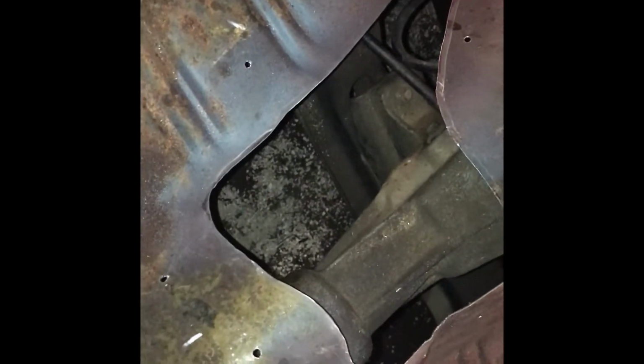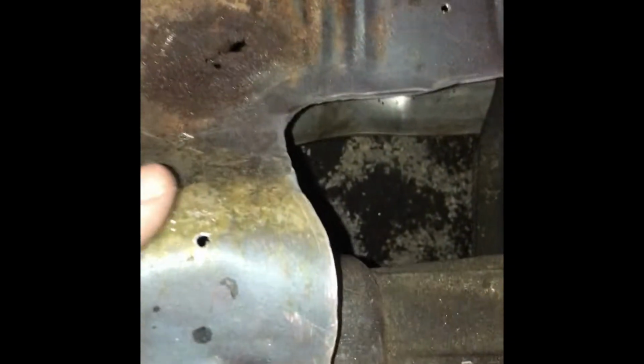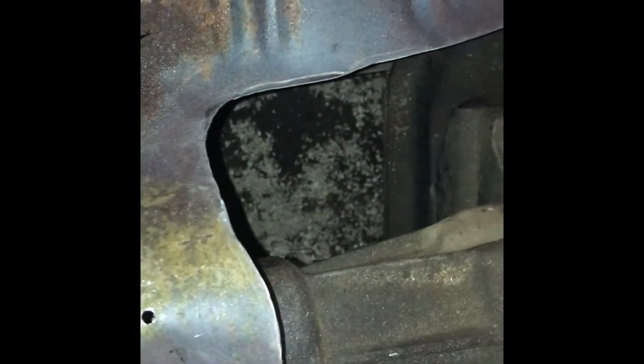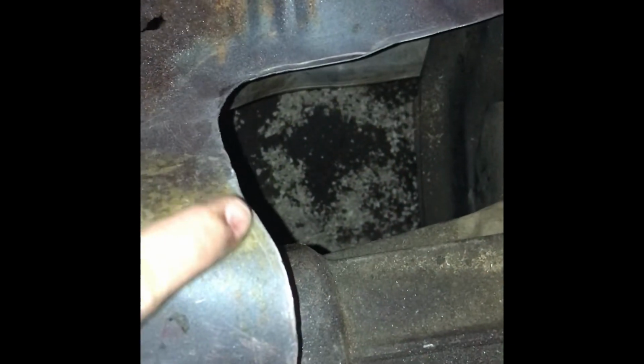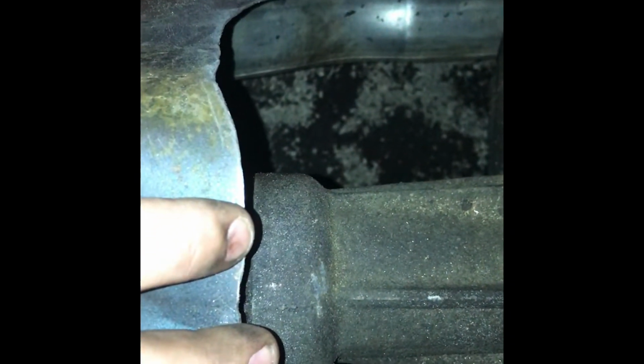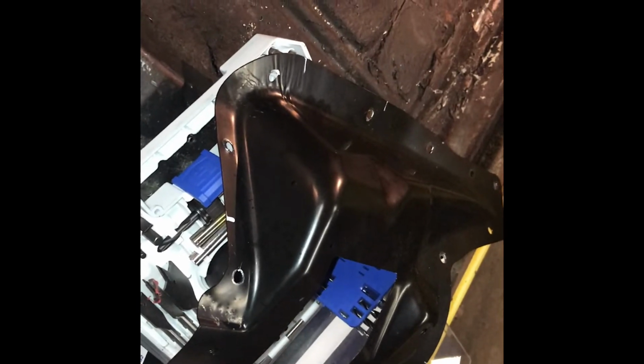And this hole, even though you could say it's not cut perfectly, like this right here, how this is straight there, it don't look like it because it's bent, but it's straight there, and then it kicks back a little bit. Well, I did that for the shifter. The reason why I don't want to cut this back any further is just right there, and that gives kind of a shield for that seal. If it ever starts to leak and sling fluid, it'll help keep fluid from coming inside the car, because it can sling up. Even though that piece is going to be in there as a cover, that acts as a little extra shield, which is why I didn't want to cut that back.